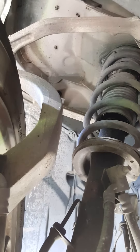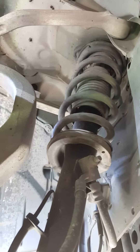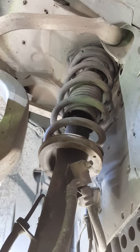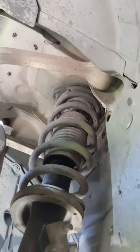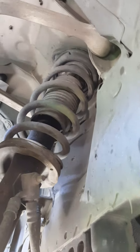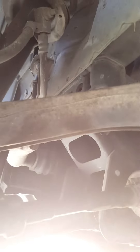The theory I've been running on recently is that either the old worn bushing was causing excess stress to get put on the strut itself — so maybe the strut mounting has come off its bearings — or it's put more strain on the tie rods.